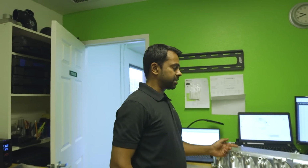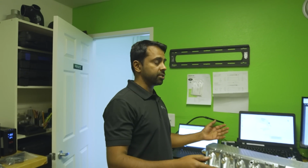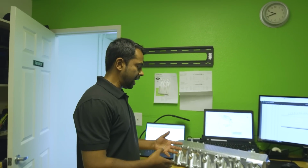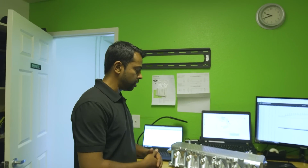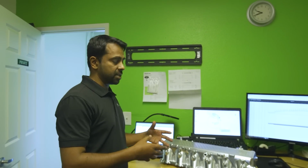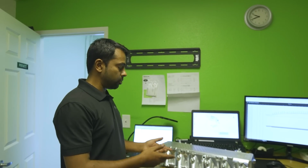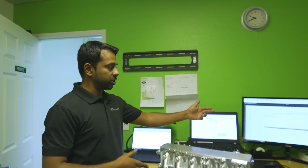I mean, we're pretty much seeing what we need to see with the gains that we've gotten from this cooler. Definitely. So back-to-back testing on the same tune, in the same conditions, on the same day, has shown such a big delta, and that's what we're looking for on the dyno. So the manifold and the heat exchanger core have given the enthusiast so much headroom for expansion and power. As you said, we've tested this on a low power variation, and we have so much headroom from bringing so much cooling capacity.